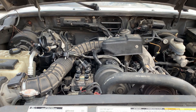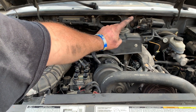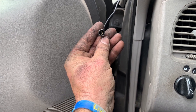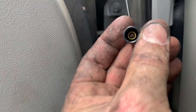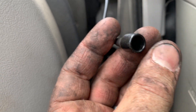We have narrowed it down — pretty certain it's the fuel injector on number one cylinder. I'm going to put a NOID light in it and see if it's getting fire. If it's getting fire to it, we know it's not a broken wire. I've got my NOID light hooked up on the fuel injector — this extension comes from Harbor Freight, pretty legit. We're going to fire it up and see if it's flashing. As you can see, she's flashing — that means we're getting fire to the injector.